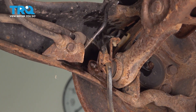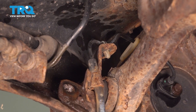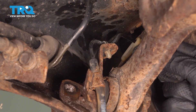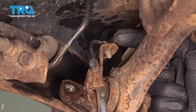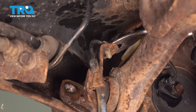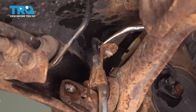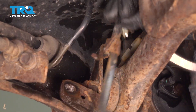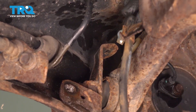Just a quick inspection of your mounting hardware as you continue on. Now for this plastic clip, you can see down along the bottom there are two small locking ears. You could try to squeeze those in and pull this up and out of place, though typically that can be difficult. Otherwise, since we are replacing this, just go ahead and pry it out of position.